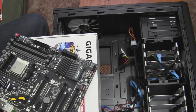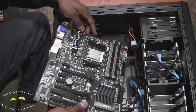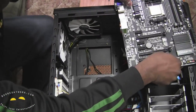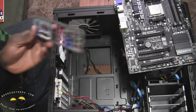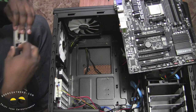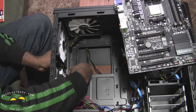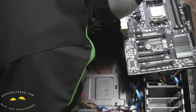This is a very solid board overall. What we're going to do is screw it down into the case, then add our memory and lock in the fan. Make sure you have your pegs already in from the previous case build. We're going to slide this in here and drop it into place. We also have to swap out the I/O shield to the new one that matches.